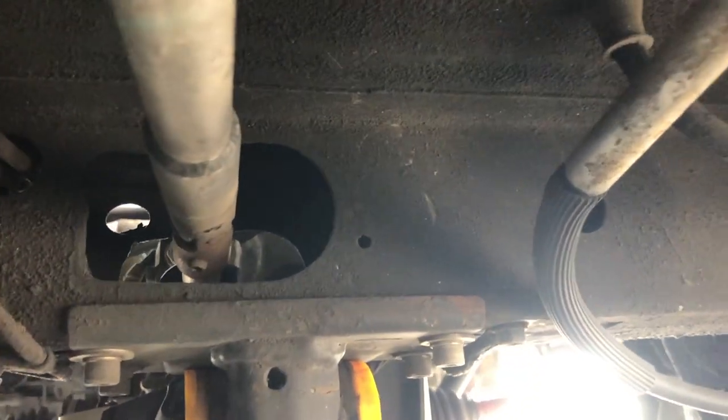You also have to cut a hole in the cross member — it's like a frame that goes to each side of your van on each back wheel, from side to side. You have to cut a hole through that in order for the shift linkage to pass through. I kind of didn't like doing that, but at the same time this transmission was going to completely transform this van, so cutting a hole was the least of my worries. I got all the shift linkage, got my axles, got the mount, bolted it all up, put the transmission all together, got all my clearances right, and started driving it.